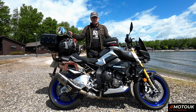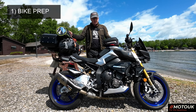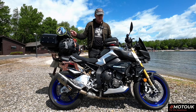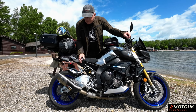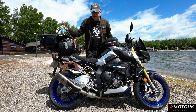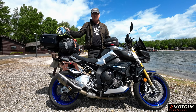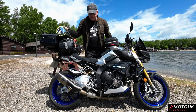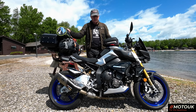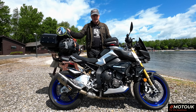First, a couple of things I make sure to get done before a long journey. Number one is bike prep — what we do to get the bike ready for a big trip. First item is the tires. I make sure the tires have got enough meat on them — I like to keep about 2,000 miles left — and make sure they're not squared off in the middle, because after a 2,000-mile trip you're probably going to square them off, especially with a lot of motorway work.